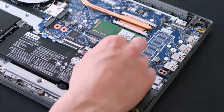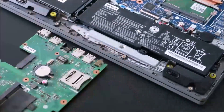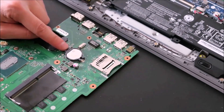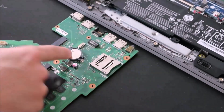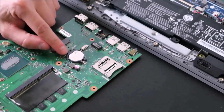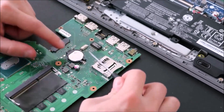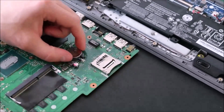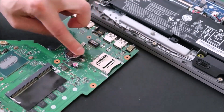Leave that unplugged for a while and then just plug it back in. If you have the other kind of CMOS battery, there's a spring that holds it in and a spring underneath that pushes it up. Push the battery back and up — but be very careful because the plastic part here is very breakable. If that snaps off, your battery won't be secure. Push in and up, and it comes out. Then leave it out for a time, slide it back in, and snap it back down into place.